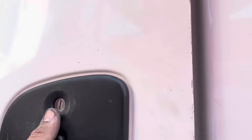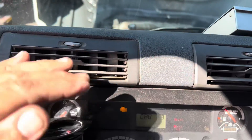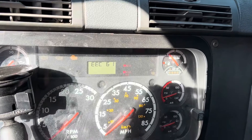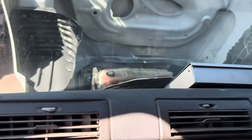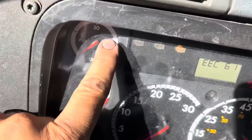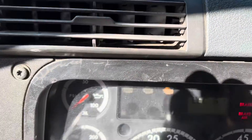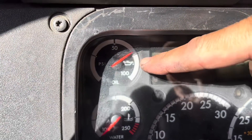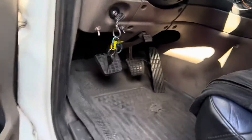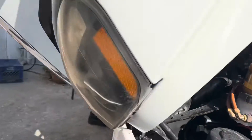Alright, let me just make sure everything is clear and there's nothing in the way. Coast is clear, there's nothing in the way and nobody's working on or touching the truck. We still have that light for the DEF pressure low. No oil pressure concern right now — oil pressure is good, just a hair under 75. Oh yeah, sounds a lot better! Let's go outside just to verify there's no extra chatter or noise. Oh yeah, sounds much better than before.